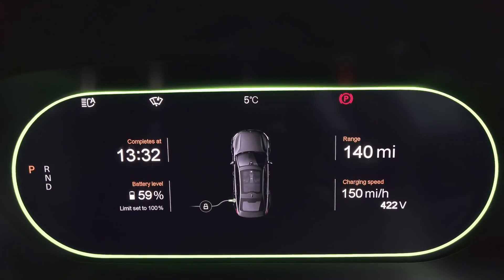About to reach 50% in the charging cycle, and the charging speed has dropped to 184 miles per hour — 184 divided by 2.6 is 70 kilowatts. That's quite a significant reduction, indicating it's throttling back from 50% onwards. Approaching 60%, charging speed has slowed to 150 miles per hour — divided by 2.6, that's 57.7 kilowatts. At 70%, the display shows 152 — divided by 2.6, we're at about 58 kilowatts. Ten more percent to go until we get to 80.